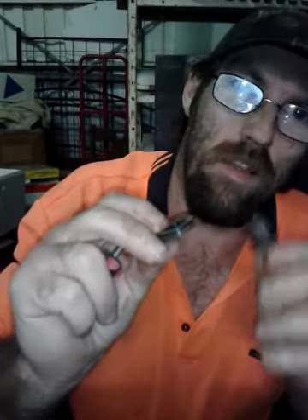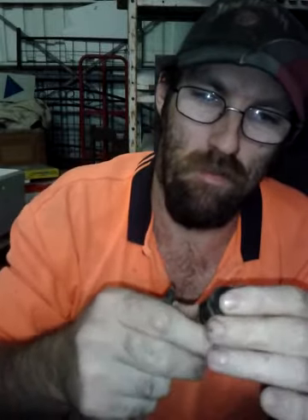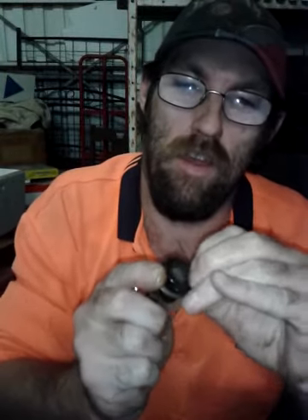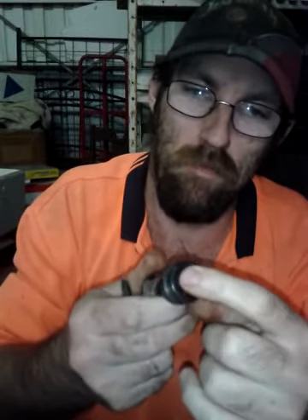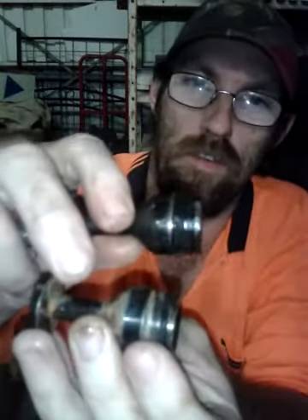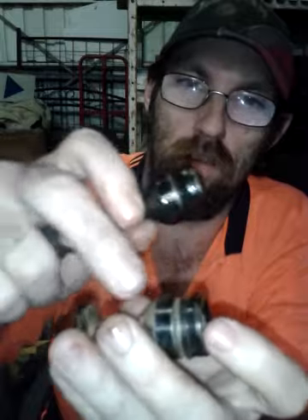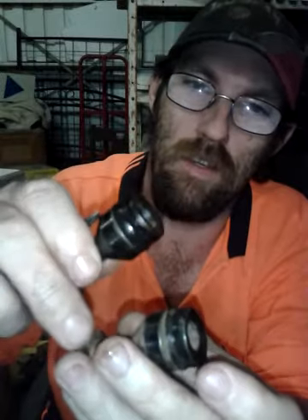This is an old one. I'll show you how to put it onto this one. It's normally best if you've got a little bit of brake fluid — which I don't have any left — to get it and pull over the top of your piston. If the ring is shrunk, it's no good. You can see the difference — old and new. When you see the old one, you'll have a big gap in between, which doesn't help. It normally lets the fluid out as it pumps through.